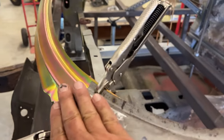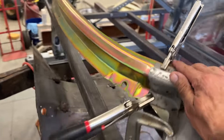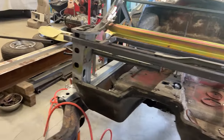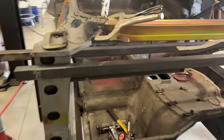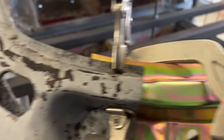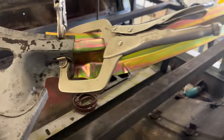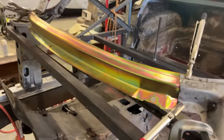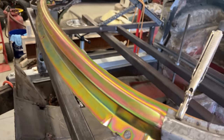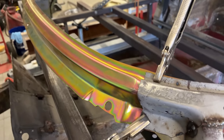I took out the old rusted lower outer windshield frame and clamped the new one in. It looks good with just a little bit of trimming needed. This part is a little higher here — I'll grind this down even with the stock one and taper it back. The part fit up pretty nicely. I may go ahead and sandblast that piece because this type of coating doesn't take paint well, so I'll blast it and glass bead the whole piece before putting it in.